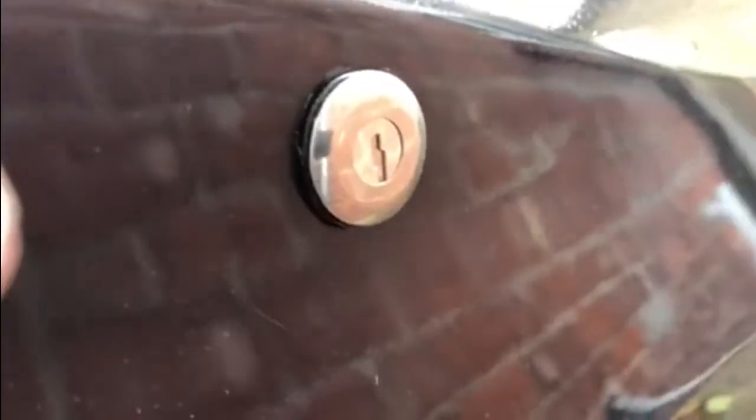Okay, so we've got the lock ready — put the gaskets on — and it's simply a case of putting that through there, making sure that's in the right position, and putting the lock in the door. That's in. Take it back on the inside of the door and I'll get that pinned in properly. You can see that's the lock in place; we've got the new bracket in there as well. I just slid that into place, tapped it with a hammer a couple of times, and it went straight in.